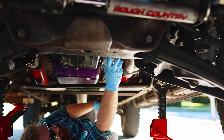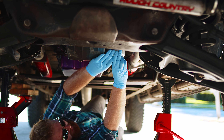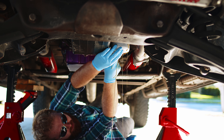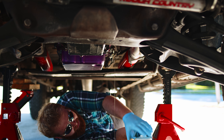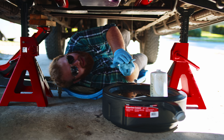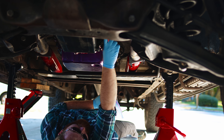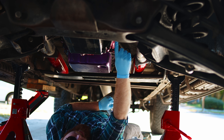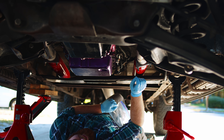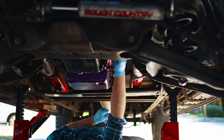This is where you get covered in oil. There it goes — it's nice new clean oil though. Filter done, now we just got to drain the oil. This oil filter holder is where the oil filter mounts, and it has oil lines that go to the radiator. Those lines are going to be in the way of some of these bolts, so we need to remove this whole assembly first. Quarter-inch allen bolts for the oil filter holder.